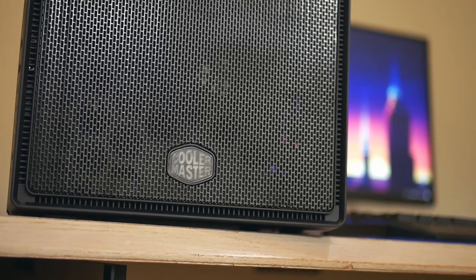Here is the final build in all of its glory. I will say that while the Elite 110 case is fantastic — it has awesome airflow and for its size performs really well — I would have gone for something a little bit smaller. The case only slightly fits into my current entertainment center, and I can see how its size could be a potential issue for smaller entertainment centers. I didn't overclock the CPU or the iGPU, but I did go into the BIOS and turned off AMD's Cool and Quiet function to prevent any downclocking. With the function on, the CPU wouldn't clock beyond 3.2 GHz and the integrated graphics chip didn't even hit 1 GHz in Dolphin or the PS2 emulator. So I clocked the CPU to 3.7 GHz and left the iGPU at its stock rated 1,250 MHz.